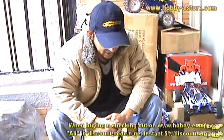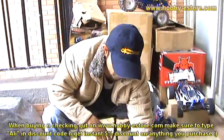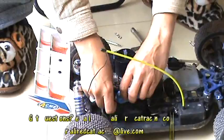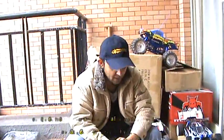If you're still having problems, check all these cables — even check the cables inside the receiver and see if they are properly fixed. Sometimes because we just shove the cables inside, they bend and break without us even knowing. So make sure you check all these cables, especially these ones, and the problem will be resolved. Thank you very much for watching, I hope you will have lots of fun.